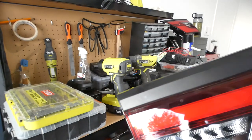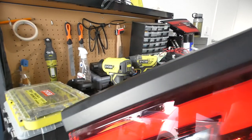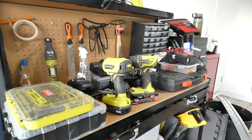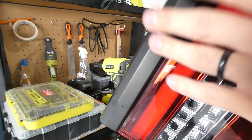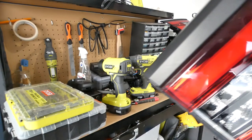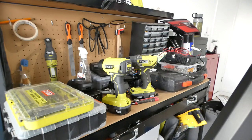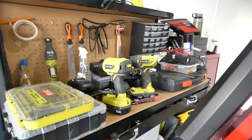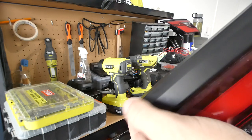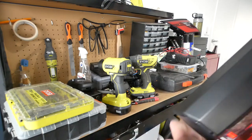Now we've got both of the lights done. It's time to move on to the patrol garnish. They weren't too bad to do. A couple of hot tips for young players: start off by putting water on the chrome — it makes it so much easier to position it where you want. Then once you've got it set where you want and it's nice and tight, hit it with the heat gun. It'll evaporate the water and set it in place. Now we'll see how we go with the patrol garnish because it has embossed letters and a slit in it, but it should be okay.